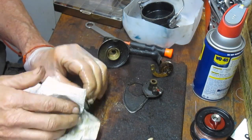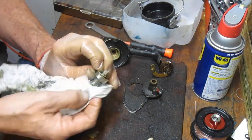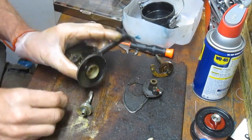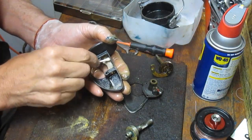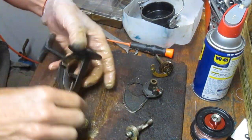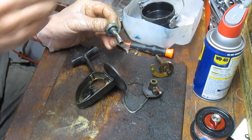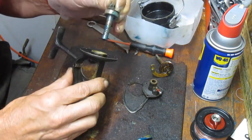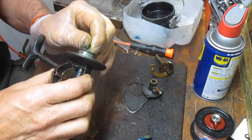Now just clean off the pinion gear. I'm checking to make sure these tracks are all clear — they are. We can reinstall this one. There's a little bit of junk underneath here — that's the old grease — let's get that out of the way. Make sure we get grease onto the pinion gear at this point, lest we forget. Put that pinion gear back in; there's a little bit of dirt in that channel, so let's reset that using a paper towel.